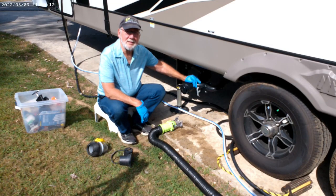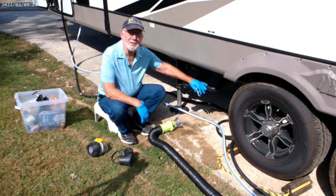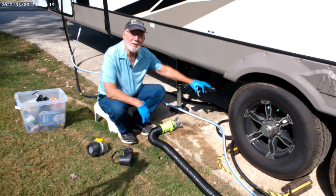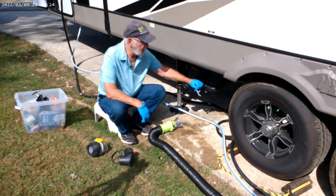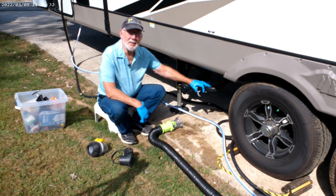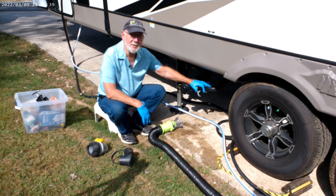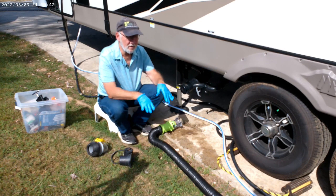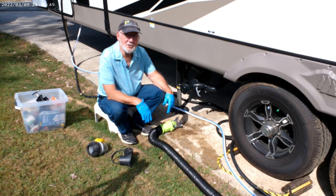In this video I'm going to talk about holding tanks. There's a lot of discussion and opinions on the internet about whether to leave the gray water tank valve closed when you're on full hookup in an RV park. I prefer to leave mine closed unless we're using the washer dryer or taking showers. The reason is solids can get into the gray water tank when you're doing dishes, and you want that rush of water to help clean those solids out. When you pull that valve open, the gray water rushes out and pulls out all those solids that would otherwise stay in there and ferment and cause an odor problem.